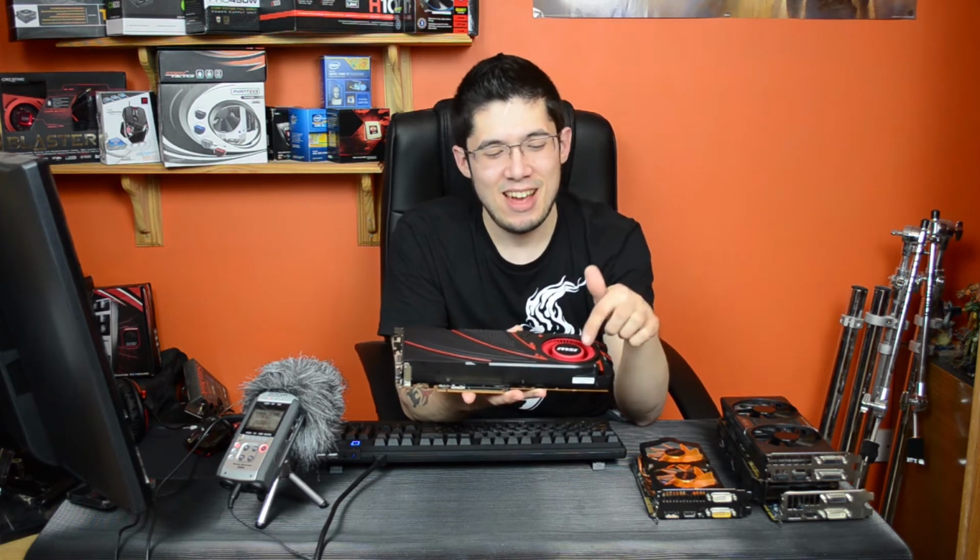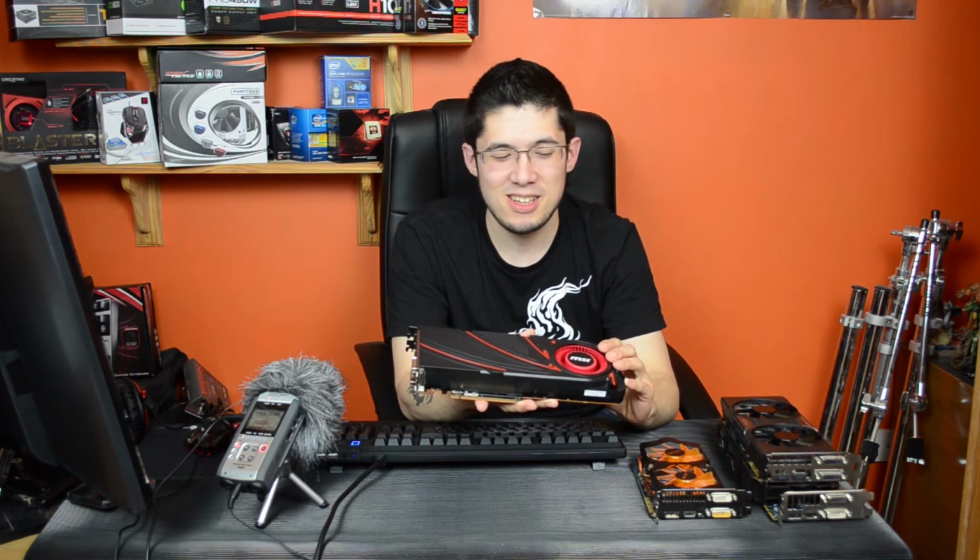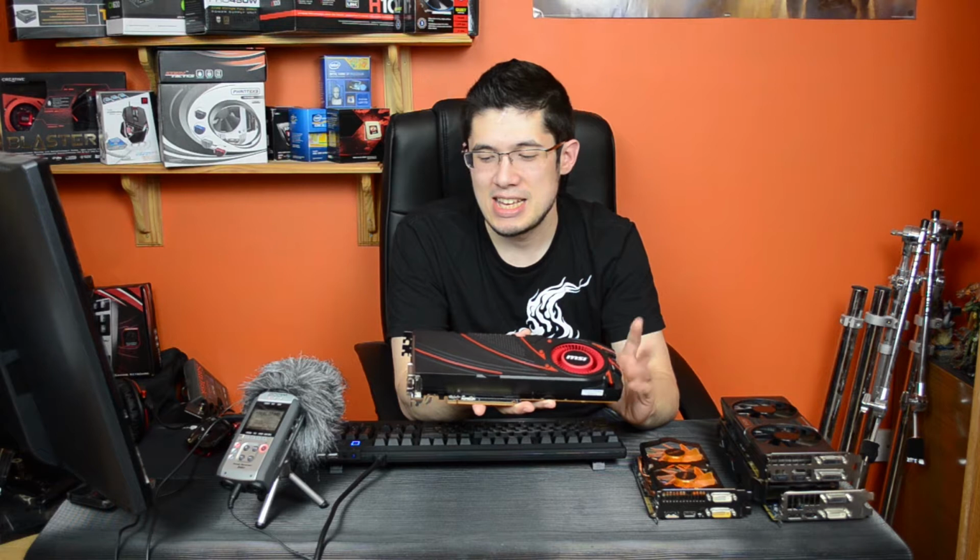But on a single monitor, even at 1440p, it really doesn't show its true colors, and its problem is that when it's loaded, it gets hot. And I mean really hot. We're talking 95 degrees here. And that's really hot, isn't it? It's Haswell hot. And this thing here just can't keep it cool at that. It gets to 95 and then it starts to throttle, and that brings it down and down and down. And that's my explanation as to why in the benchmarks this didn't fare well.